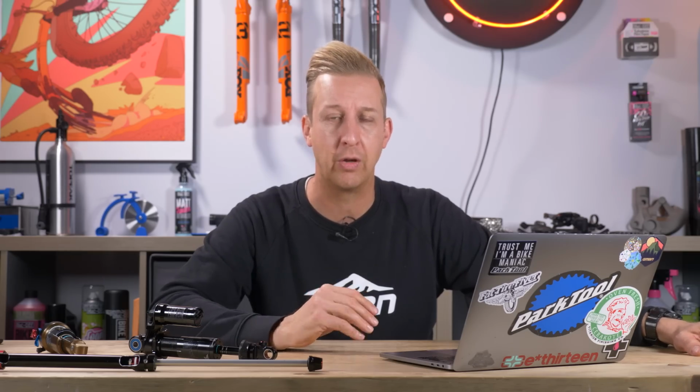When I used to ride a lot more downhill bikes, I was always a coil shock fan because that's what there was. Air shocks were creeping in on cross-country bikes, but the problem with air shocks initially in mountain bikes is they weren't very sensitive. They didn't have negative air springs in there. Some of them had a coil spring as a negative, but really they had a thing that we call stiction. You've got to overcome the static friction of the shock, and you're overcoming the air spring and the seals for it to work. They just weren't very active. So coil shock was always a better approach.